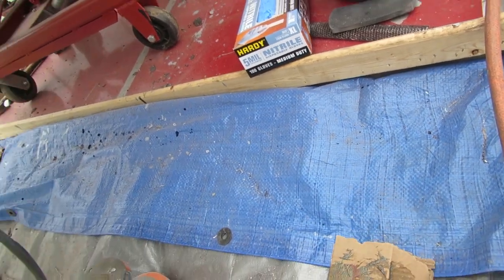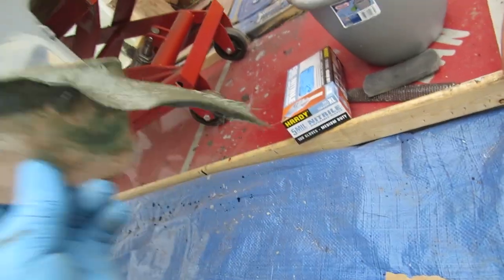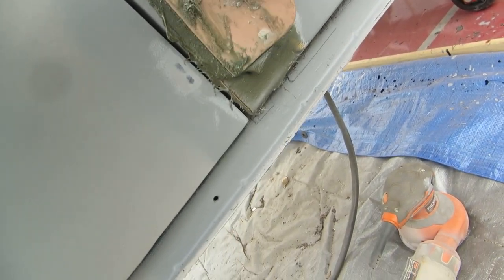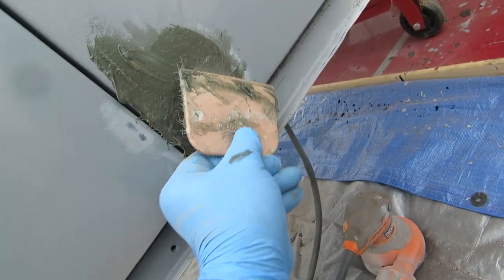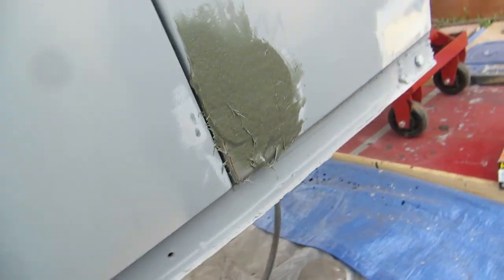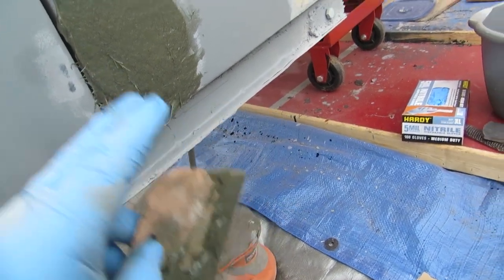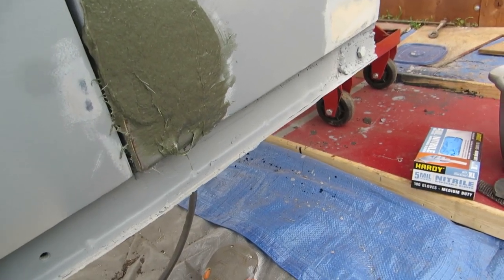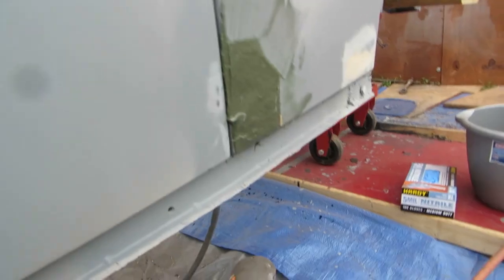The rusty trombone connotation means that what happens is, since they drilled a hole in the body of the car, it's going to get moisture in it. And once it gets moisture in it, it's going to start to rust. And then you're stuck with it, because the body man's not doing his job. Man, I'm a glass guy and I know this. Come on, some people. So we're going to lay fiberglass, much more structural, and grind that out, much more structural. And we're going to sand that down and put a very fine coat of mud over the top of it.